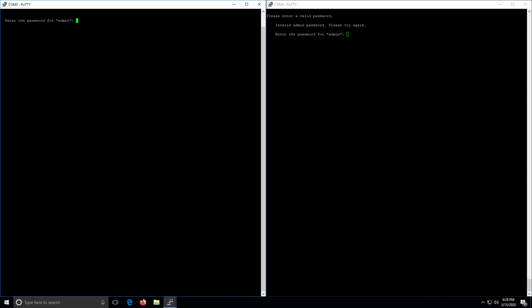I went through and cleared all the boot up stuff because it's just a bunch of junk in there. Right before this screen, on a clean install, there's a power on automatic option that will boot these configs from another device, and we're not using that, so we choose no to abort that. The default option next is, do you want to use secure passwords, and I choose yes for that, and then you're here. So you enter your passwords for your switches.